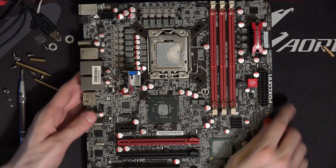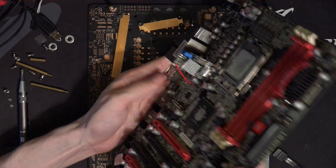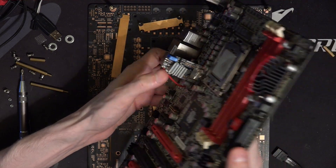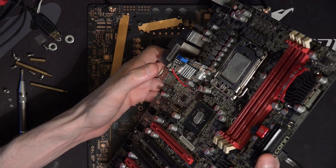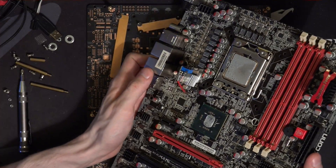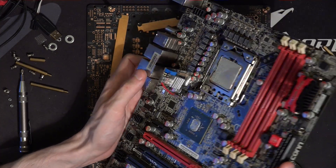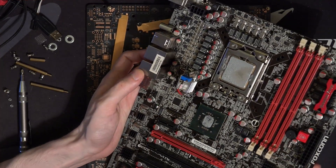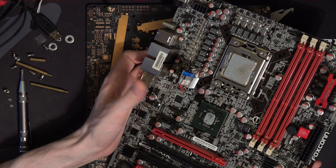After doing that, I thought: you kind of want to have independent VTT and Vcore voltage control — you don't necessarily want your VTT rail to be locked in with Vcore. So once I knew it'd boot CPUs and everything runs, I put the Ample on there. I'm not too thrilled — I think I might do a little bit more grounding on that. Also, I replaced the stock heatsink on the Ample with a bigger heatsink, because while I've not had it shut down due to overcurrent protection, it does still get pretty hot — sitting in the BIOS this thing ends up at close to 70 degrees on the back of the PCB. So I put the bigger heatsink on there, because this is probably approaching the limits of what the Ample is designed to handle.